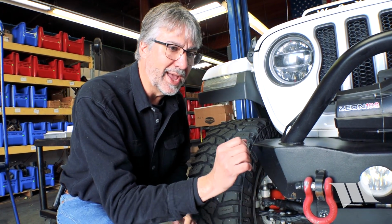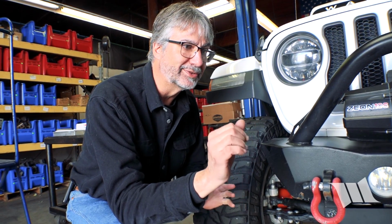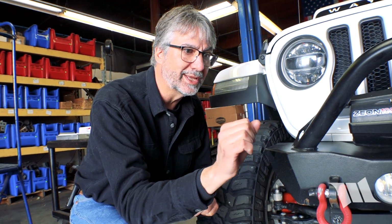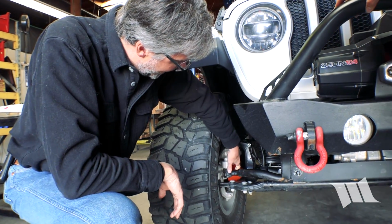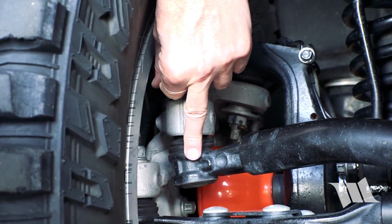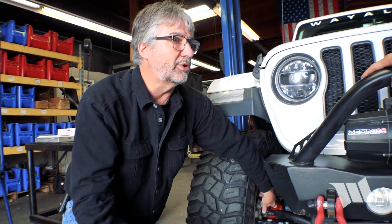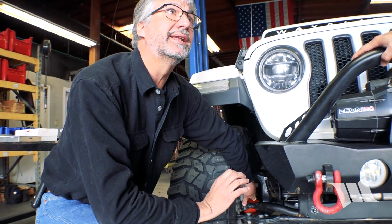And if you have someone sitting in the car, your wife, your friend, anybody can do this, they just start the engine with power steering running, and just do this with the steering wheel, just like an inch back and forth. Not a lot, but just rock it back and forth. And while that's happening, you come down here and put your thumb or your finger over the 2 pieces, because you may not see movement that's there, but you'll feel it. Just make sure somebody doesn't go crazy with the steering and get your fingers pinched somewhere. But that's all. Just put your thumb over that, and you'll feel that difference in play.